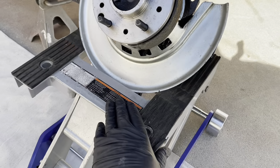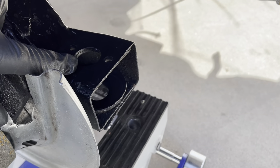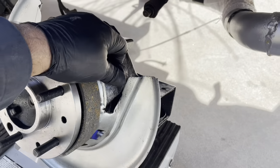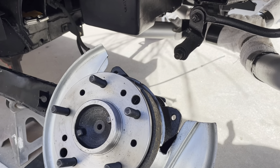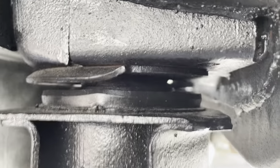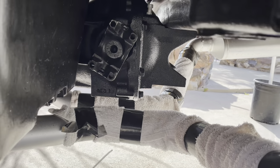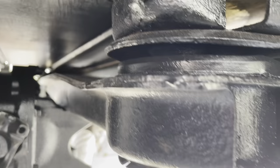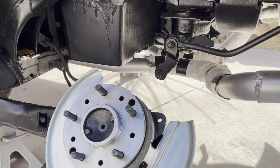I'm going to use this motorcycle lift for supporting the weight while I get this all hooked up. I've got to get the leaf spring bolt in here, and then the sway bar bracket goes on top after the bolt goes through. I think it can just hang here, and maybe I'll get the leaf spring in today. I have to lower the exhaust first, and I think this crossbar also isn't seated — there's no room between the transmission and the exhaust. I might need a couple bashes with a dead blow hammer.